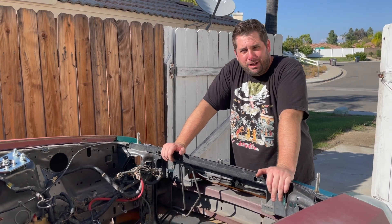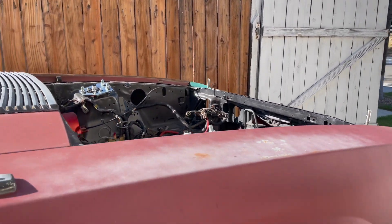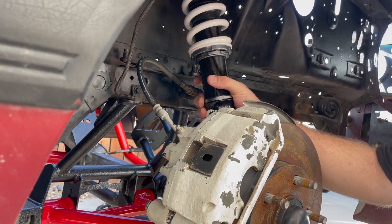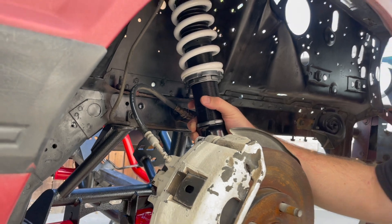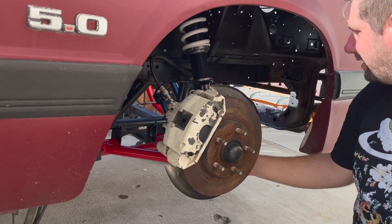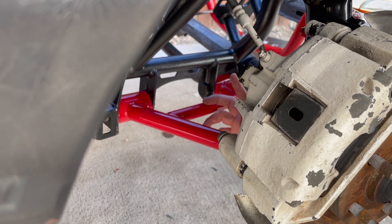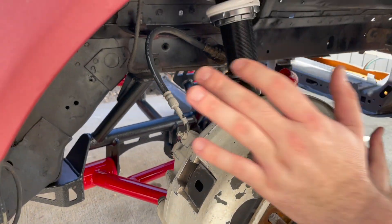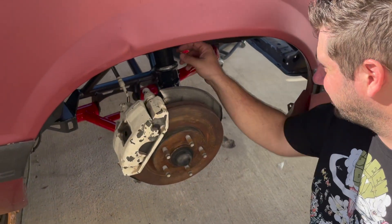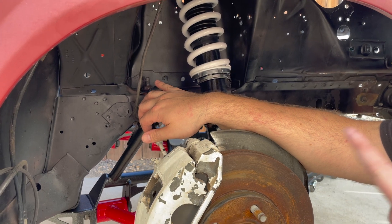It's been a day of wrenching and we made a lot of progress. We already had the subframe in. You can see we got our coilovers in — they're not fully adjusted yet because I want to get the engine in first so I can set it down on the weight and do ride height properly. They're in at the factory adjustments for now. We got the tubular BMR control arms on down here — lower cups are out since we don't need those with coilovers. We got the spindles on — these were 95 Mustang GT spindles, went right on no problem. It looks like the brake lines from a 95 GT will just go right on an 85 too, which is good to know.